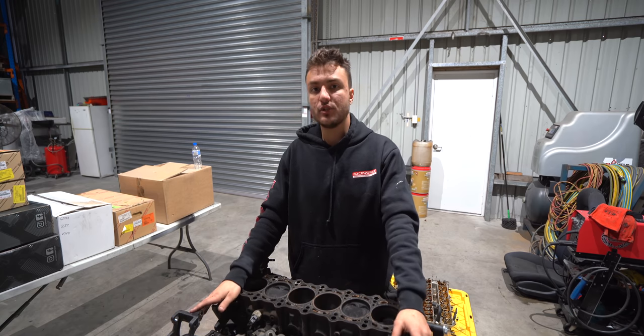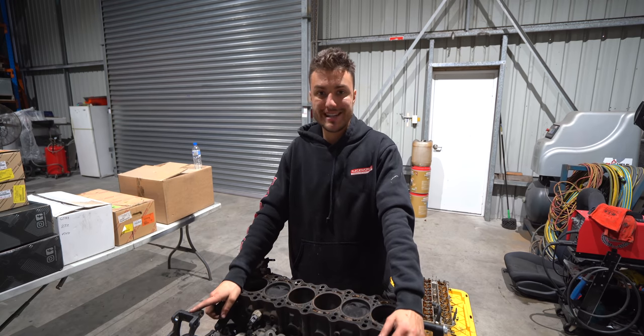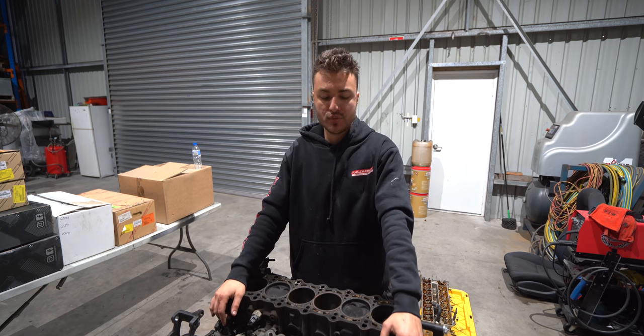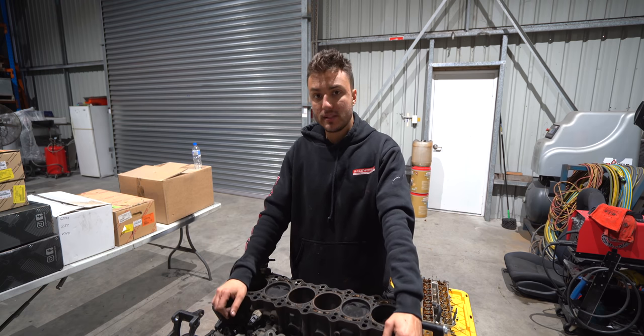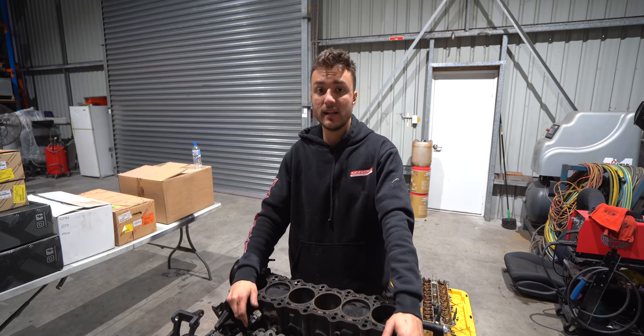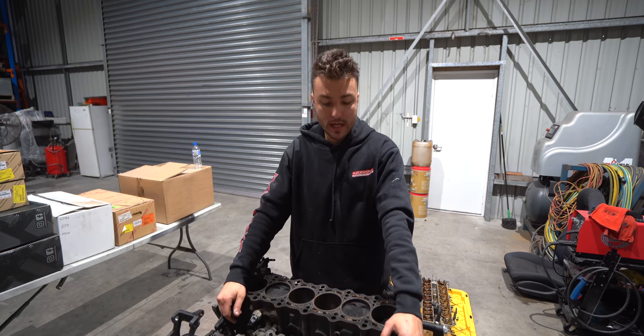I'm pretty sure the factory 2JZ turbo engines are a 9-to-1 compression ratio, while the naturally aspirated are a 10-to-1 compression ratio. Do keep in consideration that the real street Supras that you see running 6 and 7 second passes run 10-to-1 compression ratio engines.